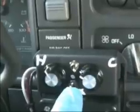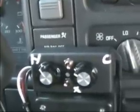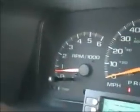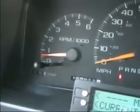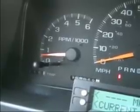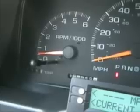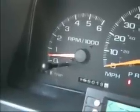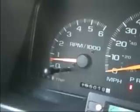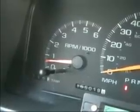We have the switch in the on position and we've already made our adjustment — we're on the city side, switched over to the right. That's the first setting you've got to make. You make this by moving this knob right here. You can watch the tachometer and also hear the engine as you tune this knob. As you turn it clockwise, the engine is going to start to try to stall — the tach is going to start dropping. It's starving for fuel. Once you start feeling it trying to kill, bring the knob back counterclockwise until it stabilizes and reaches the smoothest spot without going too far counterclockwise.